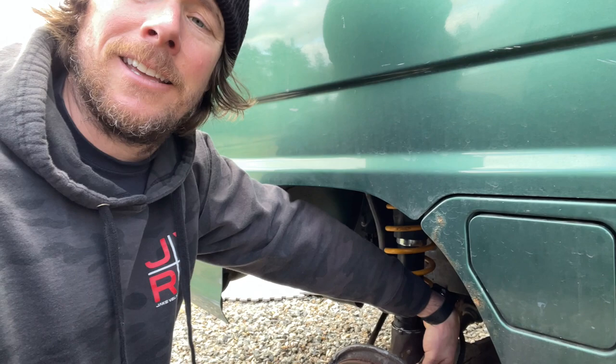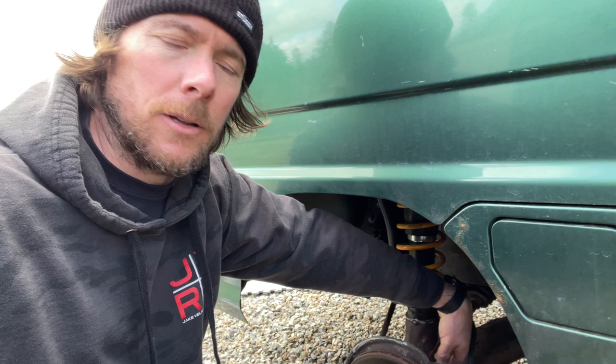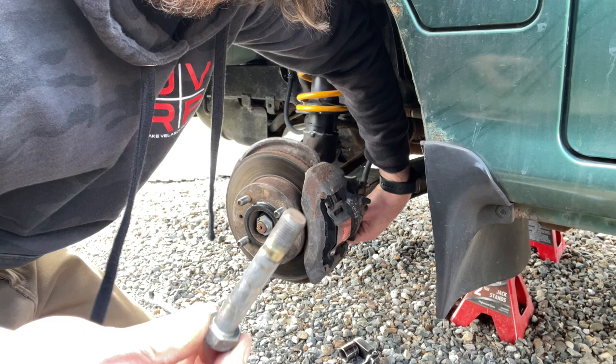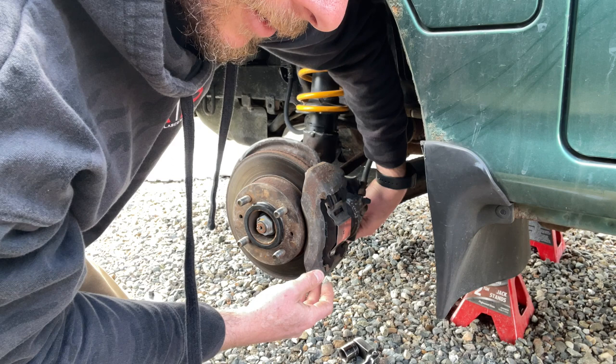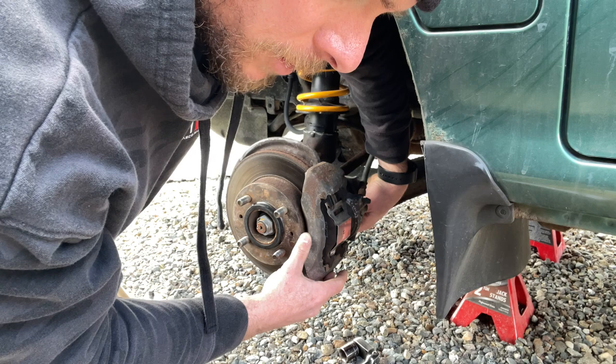And since I am just doing the rotor, I'm not doing anything with the caliper. So if you wanted to see how to change the brake pads, again, I do have another video. I'll maybe put a link in the description for that video. But again, today, just rotors. And I did put anti-seize on these when I put the whole thing back together, because it is sliding. Those are, I can't remember what they're called, the bolts that the caliper sits on with the sleeves. So I didn't want it to corrode and all that.